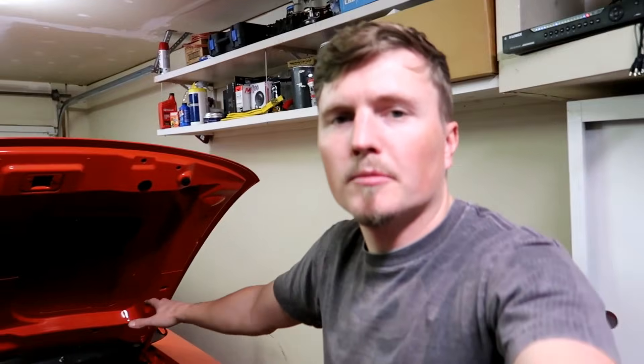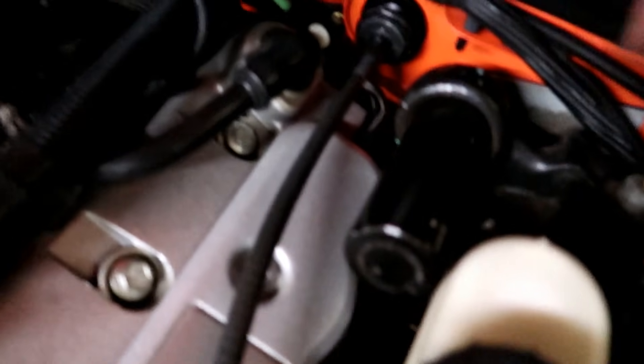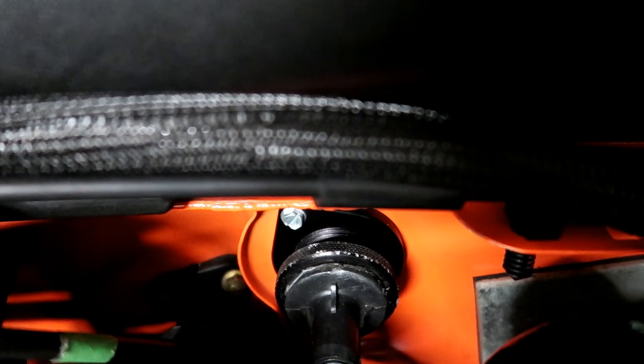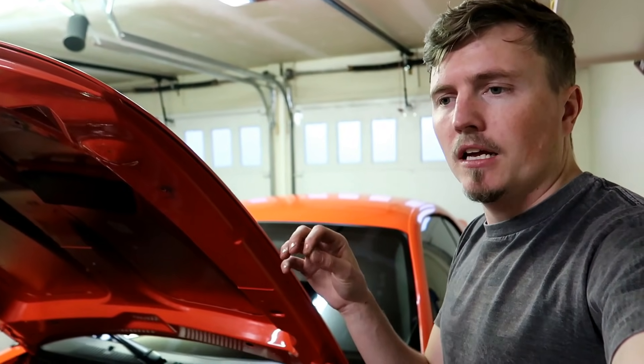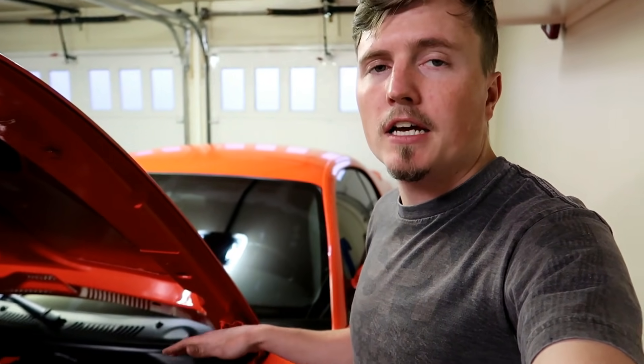Right here is my setup. If you look at the firewall adjuster — right there, that's it. It's kind of hard to see; mine's got a little marring on it from where I grabbed it with vice grips to spin it. But this is what your cable rides on, and you just spin it: counterclockwise comes out, clockwise goes in, just like any regular threaded bolt. As the cable comes out it's pulling the slack and essentially shortening the cable. It is very important to have it nice and tight.